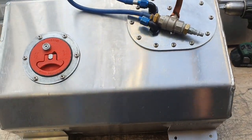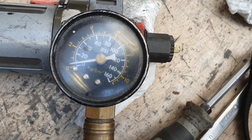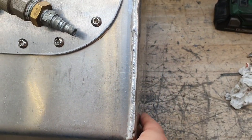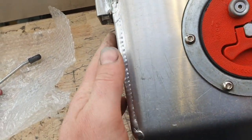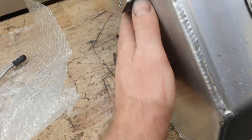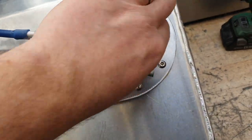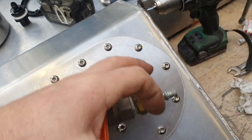It's a bit of a preliminary test with no fluid in there. Depending on where you want to read the gauge and argue about its accuracy, we're at around seven psi somewhere in there. Tap's turned off. You can see the ever-so-slight bow in the end tanks — there's a lot of pressure on there. A very slight curve, but no plastic deformation — meaning if you take the pressure away it goes back to its shape. I'll put some water in it for the proper test.